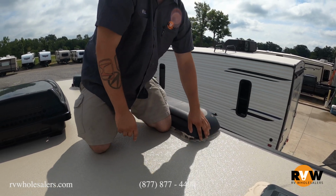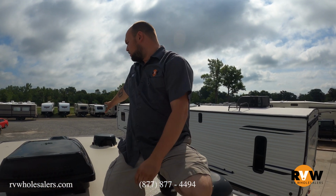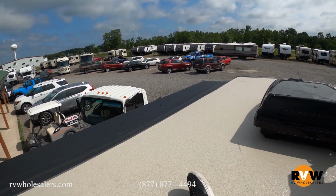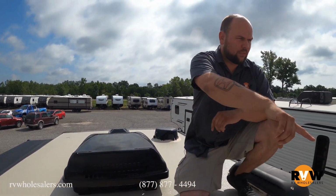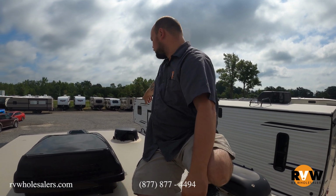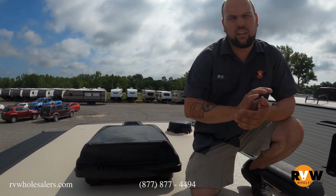So what you do, you seal that up, and that's going to be everything around this whole entire unit with the exception of the air conditioners, because the air conditioners use a foam padding to seal. So everything around here, the skylight, your vents, as well as your front and rear extrusions, they all have this sealant on them.